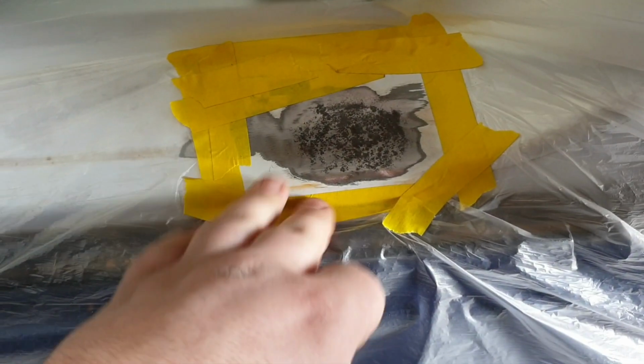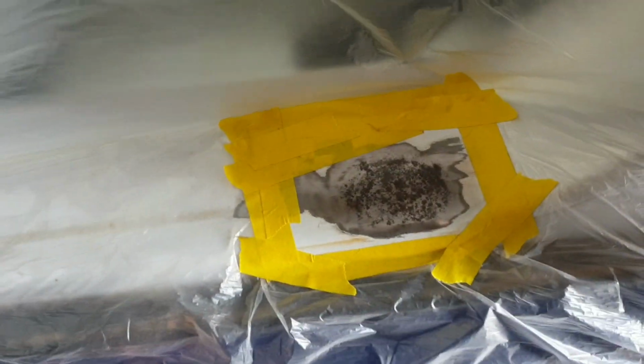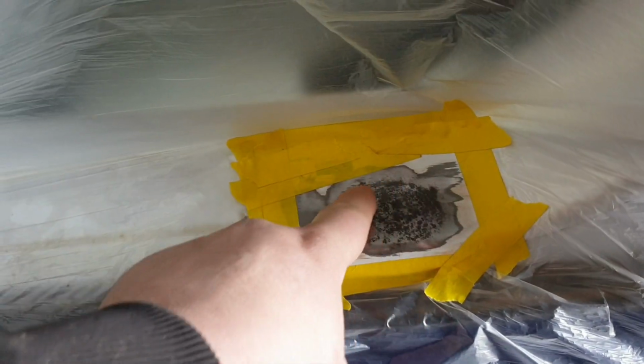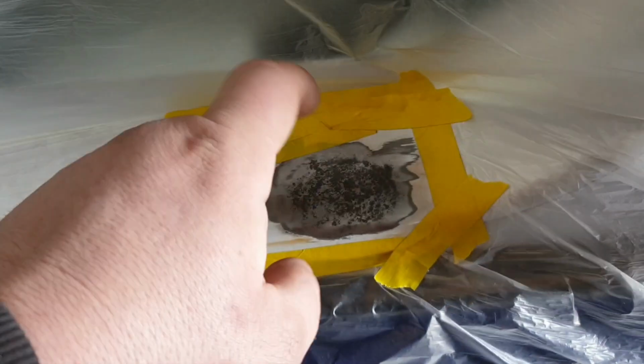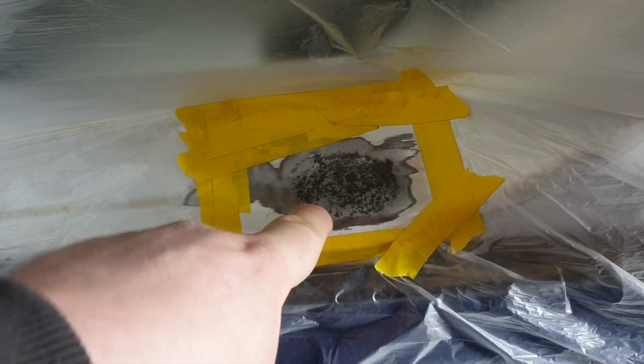So we've run the plastic wheel over this, one of those on a die grinder. Turns out there are no holes here, which is good. Now we're just going to sandblast this thing, and it is very solid. I've stabbed it multiple times. And if there's no need to weld this car, there's no need to weld this car.